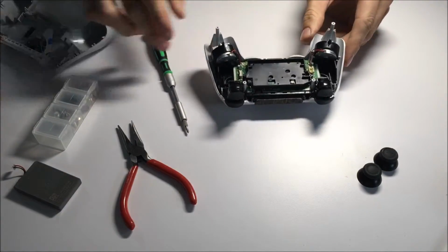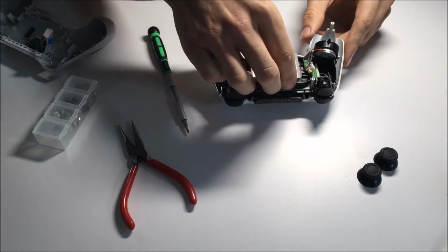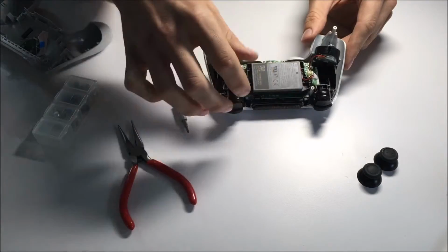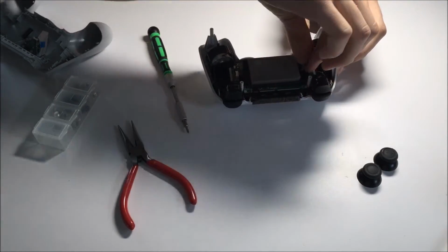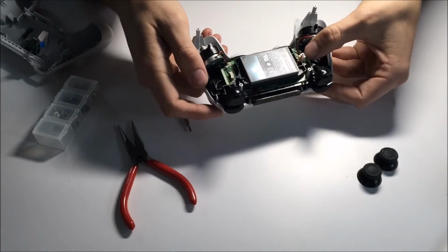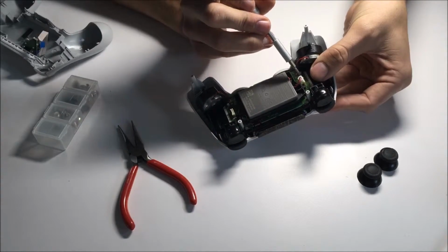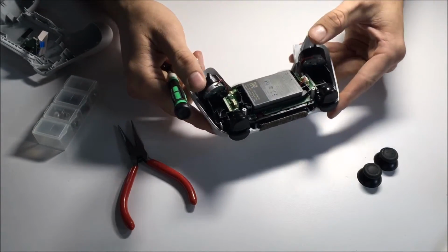And from there, I like to put in the battery first. It doesn't have anything to hold it in necessarily, just a small hook there to hold the Molex connector down. There we are, just plug it in and then slightly press. I like to put my fingernail over the plastic and also over the edges of the connectors just to make sure that they don't get pushed out, because that sometimes does happen.